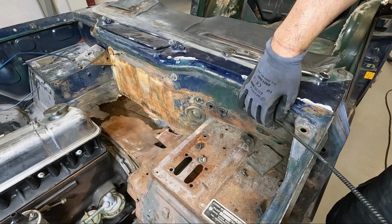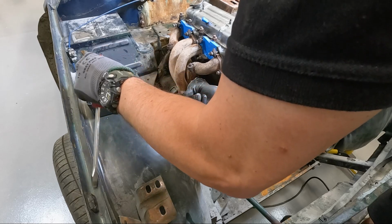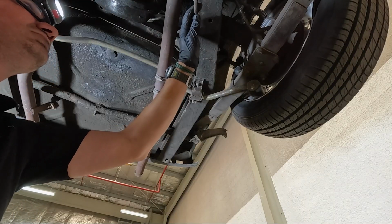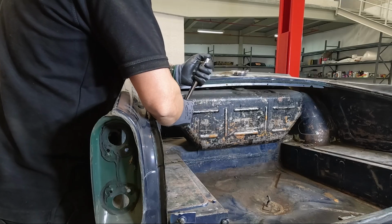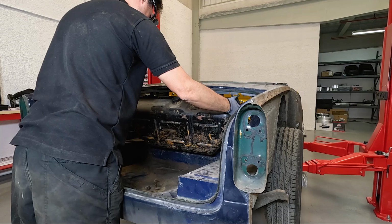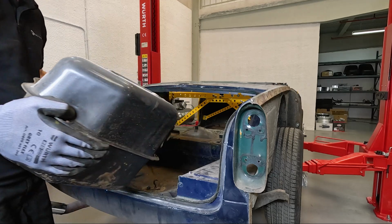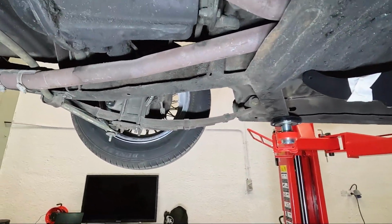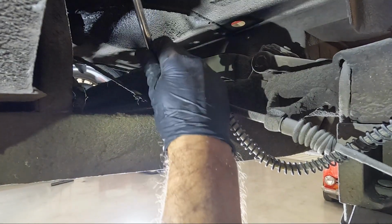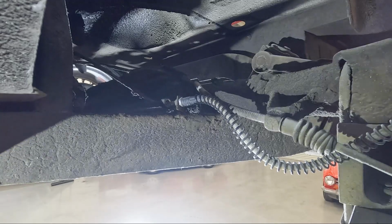The windscreen wiper motor and the cable, and then there's removing a little voltage, I think it's a voltage junction or voltage regulator, a couple of horns that were on the car, the fuel line from the petrol tank, and then the tank itself, and the filler cap and neck. And I'm removing it a little bit gingerly here because there was still a little bit of fuel left in the bottom. I didn't quite do a good enough job of draining it all. This is just peering up as a reminder to remove the 2 handbrake cables, to pull those through, and then lastly just to remove the rear brake cable fitting, otherwise they snag between the chassis and the body.